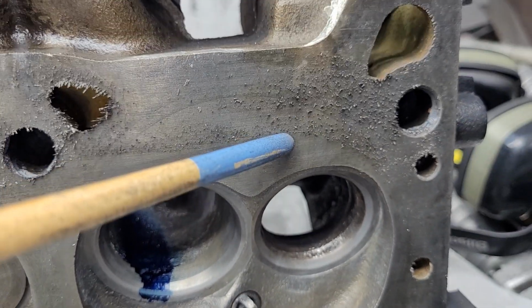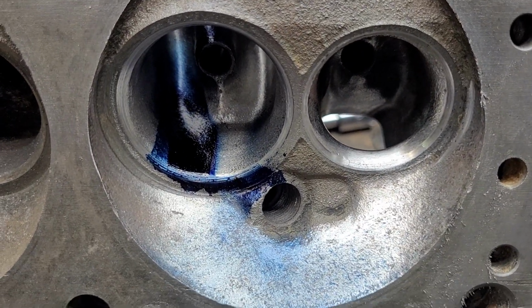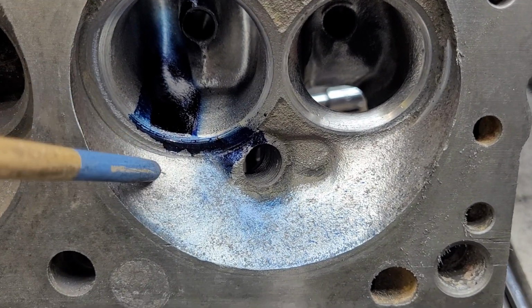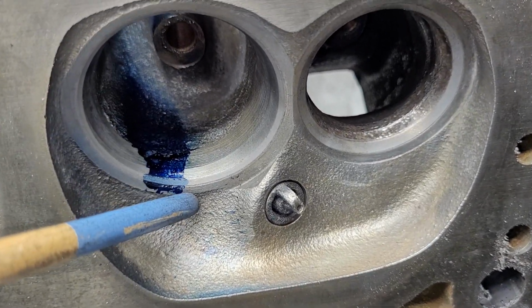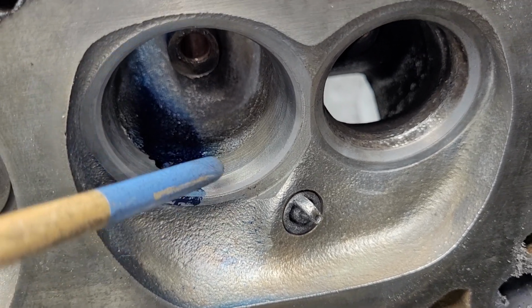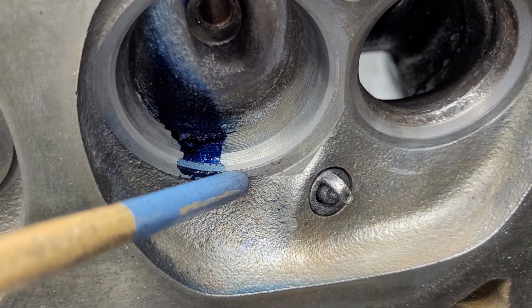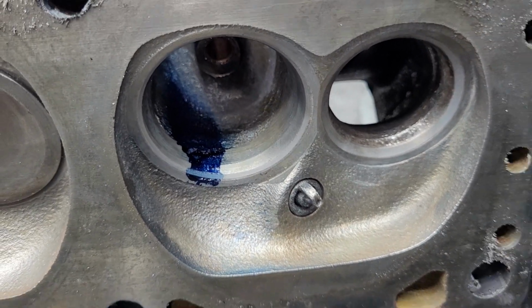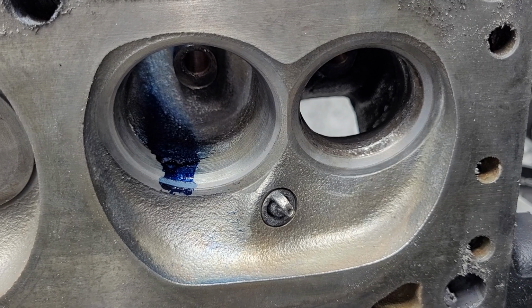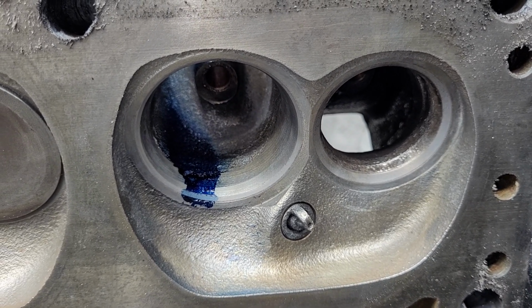Okay, it's got a nice quench right up here, right? Heart shape, beautiful. It's all good. It's definitely a huge step up from this open chamber. Probably the only thing I like better about this chamber is this curve right here. That's about it. Because when you're coming out, that's probably one of the reasons it has a very flat top angle, like a 20. They're bending the air to match that flat part of that chamber there. I would much rather have a steeper top cut and have it blend right into more of a curved chamber. But as it is, this is light years ahead of the old LA chamber. Much faster burn. And it definitely has a little bit different spark plug angle.